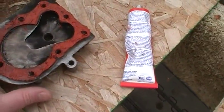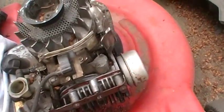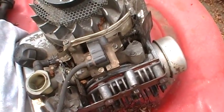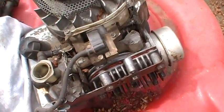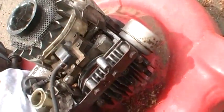It's a quick way to get by and it'll work and last a long time. Next I'm just going to put this on the lawnmower, put the bolts in, and let it dry. Here I've got the head gasket on. You can see when you torque it down it'll kind of squish out a little bit, so I try not to get it too much near the inside. You're going to get some on there anyways, but it's pretty soft and should just cook through the engine.